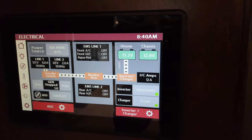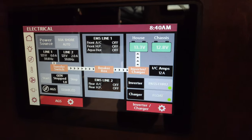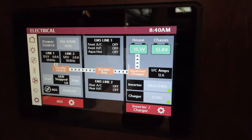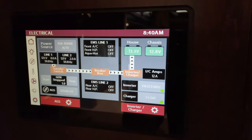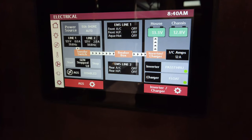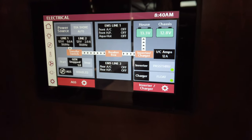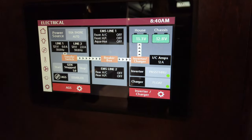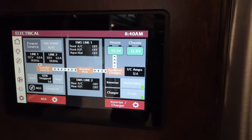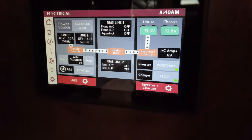If you step down all the way to 15 amp, you've got to be responsible enough to know you can only do so much. I do not recommend running a 15,000 BTU heat pump on 15 amps — you're maxing the limit. Where it says 50-amp shore auto, if you use a step down, it'll automatically assume it's only 15 amp to protect itself from letting you fire up the HVAC. If you are using a 30-amp step down, you'll have to come in here and manually tell it it's a 30 amp, because the system has no way to know — it just knows only one line is being fed.